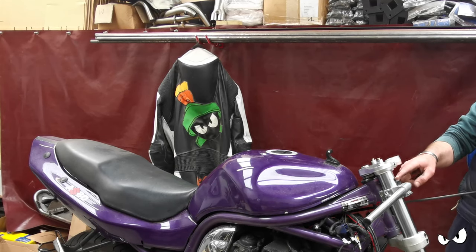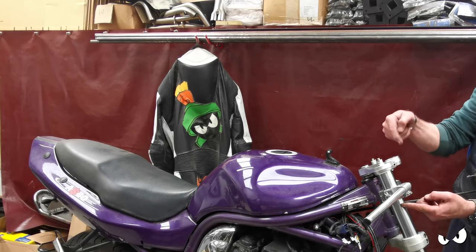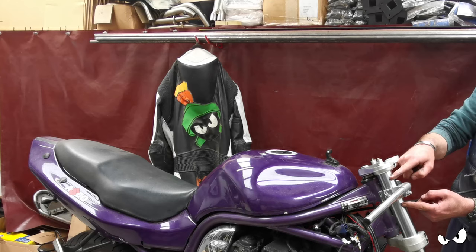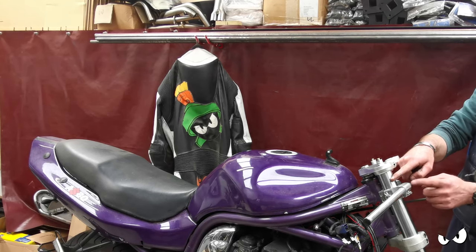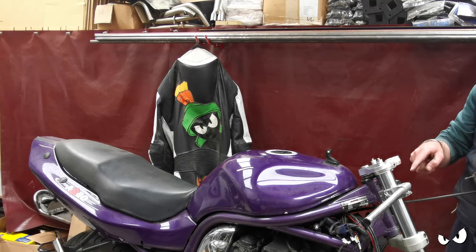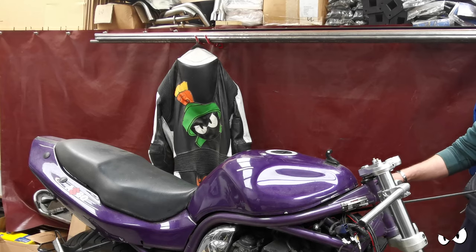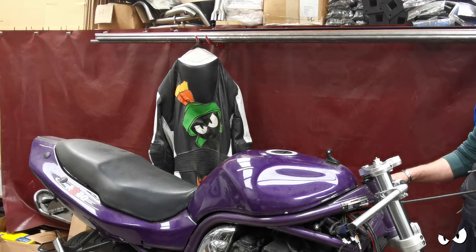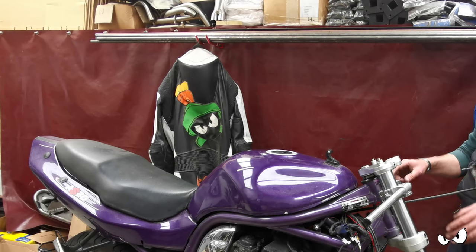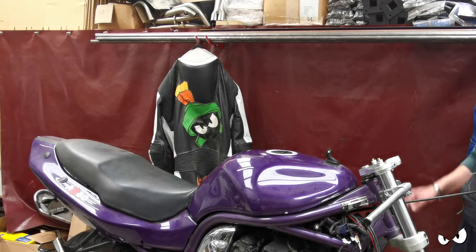So if I make the top yoke a bit deeper, not so it slopes down, so it starts there, but it's a deeper top yoke, and I can stick the clip-on straight through the top yoke. And that way there's no mucking about with setting the angles of your clip-ons or anything else. It's all just built into the top yoke. So that might be a change that's coming.